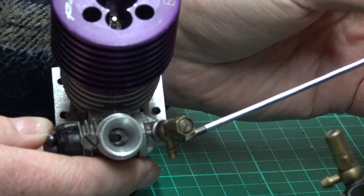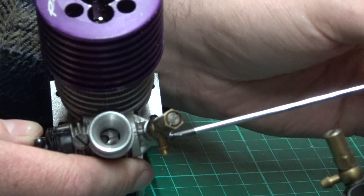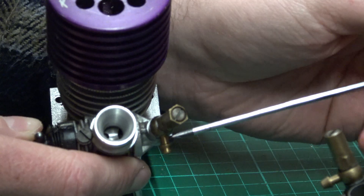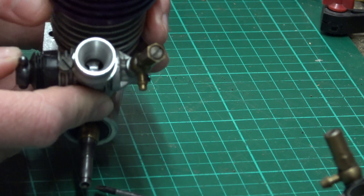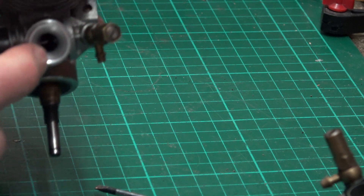I'm holding that screw, holding the thumb in, and I'm going to do the screw up, and you'll see it's going to force the throttle. Can you see it forcing the throttle open slowly as I do it up? Now it's forcing the throttle — that's going to be a very high tick-over now. That's all the way in, it won't go in any further. So as I've done that screw up, it's pushed on the throttle slider and pushed it open. So now we've got a very big tick-over — that would probably be shooting down the field on its own. You can even see in there the screw poking through at the top left-hand side, just about where it would push on the throttle.